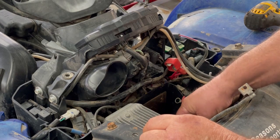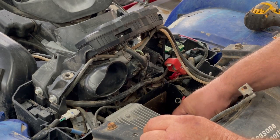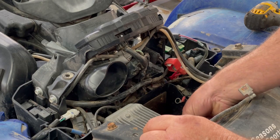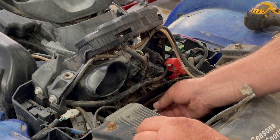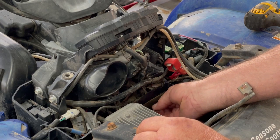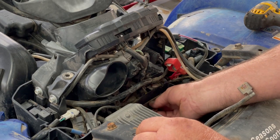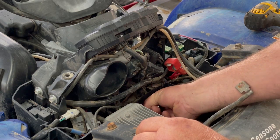A lot of these four-wheelers that are fuel injected — everything's all electronic. The best thing to do is actually unhook the battery and put a trickle charger on it. That's the best way to charge these batteries. Either take the negative off or the positive off, or just take them both off and trickle charge it. Because sometimes people will put the charger on there and put it on boost, and it just fries everything out.